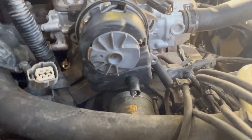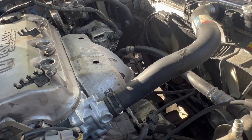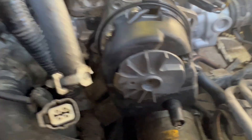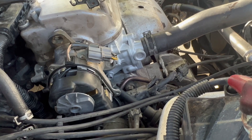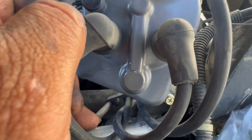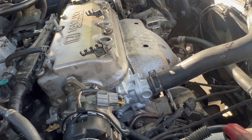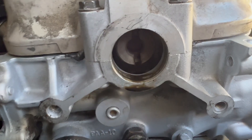That's the way to go. Now if you see, it's pointing to cylinder one. The rotation is going to be clockwise — that's what is on that position. When it cranks it's going to start and make the spark on the first cylinder because this is the way to go. I've got piston number one all the way to the top — TDC — and that's why this notch right there looks like that, because it's right on TDC. So I'm going to put this one in there.